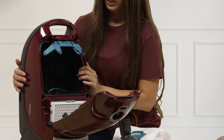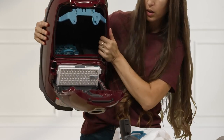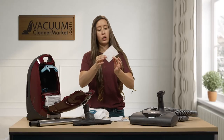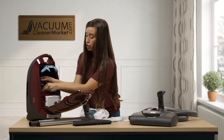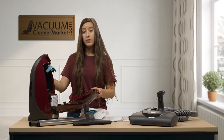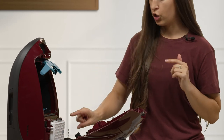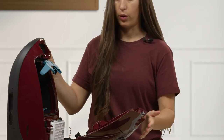Inside the canister there is a pull-down lever that houses your motor filter. Change the motor filter every four bags, or one box of bags. Your HEPA filter is good for about 50 hours of use, which equates to roughly one to one-and-a-half years if you clean a few times a week. The HEPA filter comes pre-installed — just remove the small piece of plastic and you're good to go.